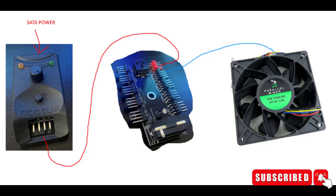I do have a video on the certain types of power connectors — I'll put the link below. The molex is generally rated around 154 watts, so you can run about four of these fans at maximum draw, which is roughly 120 watts. If you start running five or six, you run the risk of burning out wires and melting things — and you don't want to melt anything.